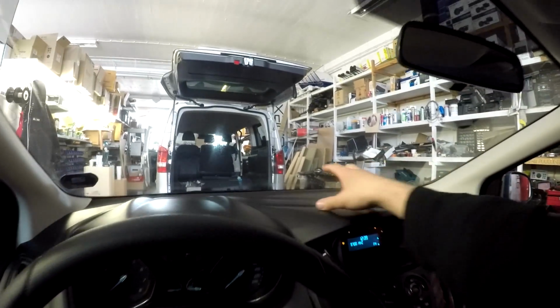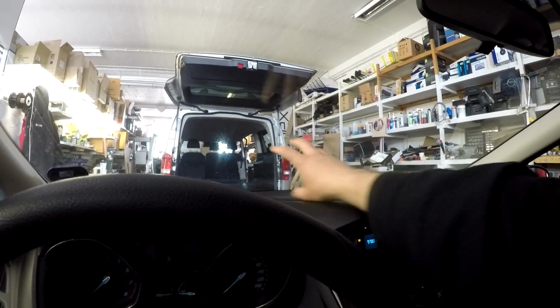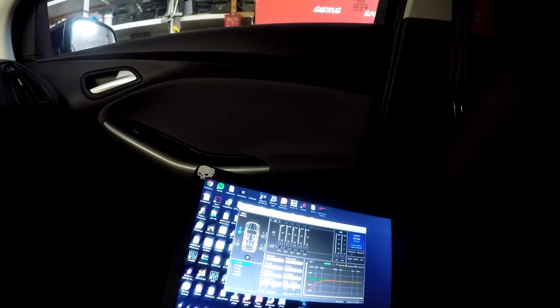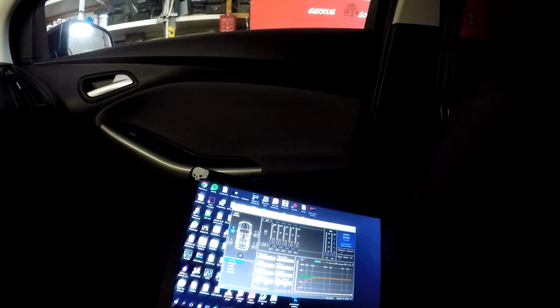This car is ready. The stereo image is nicely at the front of the car. It's around this section here. It is not very precise because we have the back speakers on, but when we lower them down to 6 dB, it will actually help the stereo image. And one more thing to show here, usually you should attenuate the front left speakers a little bit, like minus 1.0 dB, just a little bit, because it's closer, silence it just a little. And now everything is set up.